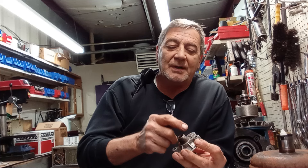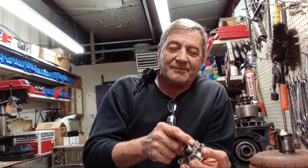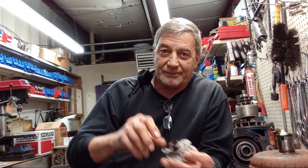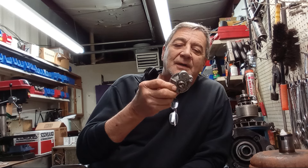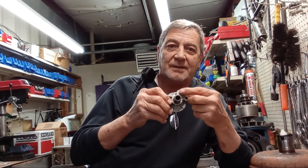It's pretty low oil pressure. What happens is if your oil filter starts to get plugged up, in order to get oil to your motor, it'll push that bypass valve down — there's a spring in there — and let oil go ahead and circulate through your motor. The question you have to ask yourself is: we plug these things up on our drag motors because we don't want any contaminants from the oil to get inside and start eating up the parts of the motor.